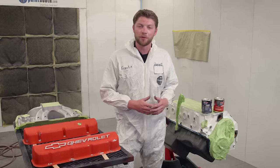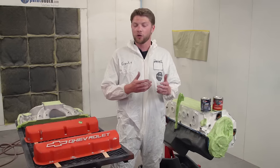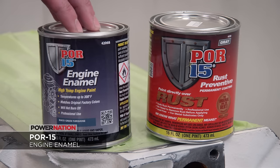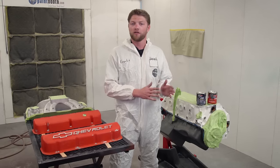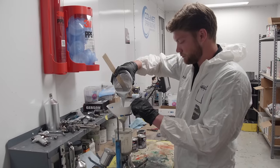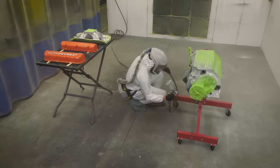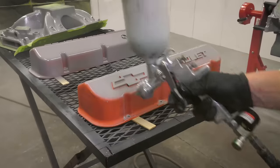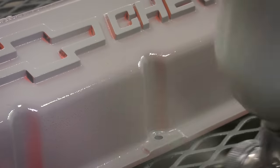We're not only revamping this engine mechanically but also revamping its look by painting it with POR15 engine enamel. POR15 is well known for its rust preventative coating that can be applied directly over rust, sealing it in and keeping it from spreading. We'll use that as a base foundation and then paint the engine with Buick Green Turquoise for a unique look that's still from the GM family. The POR15 engine enamel is good for up to 300 degrees and comes out with a smooth, glossy finish. We also plan to add some black accents. A small amount of thinner is added so it can be sprayed rather than brushed on, and a few light coats followed by a thicker coat provides an excellent foundation.